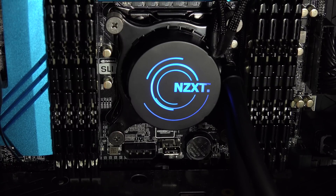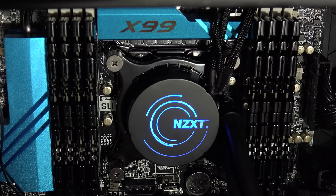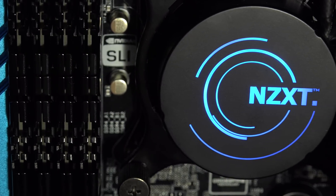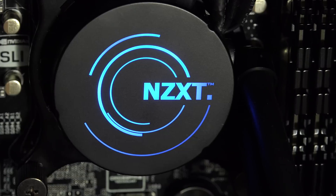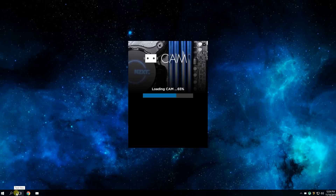To make matters worse, the icon in the system tray was still there, so if I were to glance down I would just assume it was working fine. I was so focused on what I was doing that the fact that the fans were not speeding up anymore never occurred to me. So for about an hour, I was editing 4K video and reaching temperatures of over 80 degrees Celsius. When I went to export my video and started the encoder, after a few seconds I realized the fans were not kicking on. As soon as I clicked the icon, it disappeared. I found that my processor was already at 89 degrees, and I had to stop the encoder to give myself time to relaunch the CAM software, which takes almost 30 seconds to load. This really worries me because at some point I might be away from the computer when the software crashes, putting my CPU at risk.